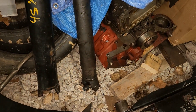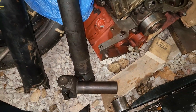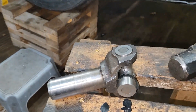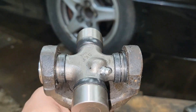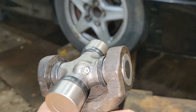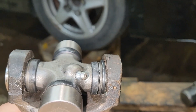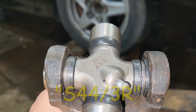This is Christopher's driveshaft — his was stuck too. I had to take that back to the guy with the 400 transmission shaft. I took this shaft off of Christopher's driveshaft that was sitting over beside the other one, and I'm just putting these back in. I like to never got his off either. So what we bought was 1350 to S44 U-joints — we got them at NAPA. I thought this was a 1310 or 1330, but Chris's S44s fit perfect, I mean perfect.